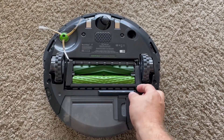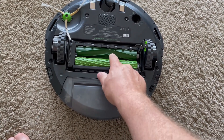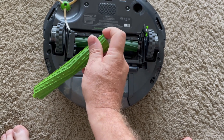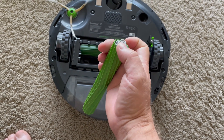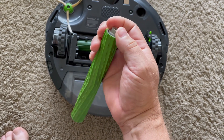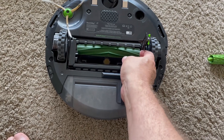I've had that complaint from my Roomba many times before. It's easy enough to look at these brushes and see nothing's wrong, but I often miss that sometimes there's hair wrapped around here — actually, all the time there's hair wrapped around here, and that can cause some binding. The thing I just noticed is that if these gray parts aren't spinning freely inside here, it's going to have problems.